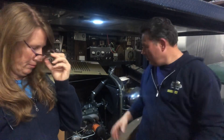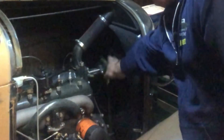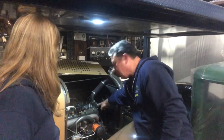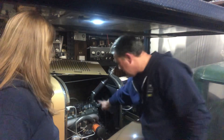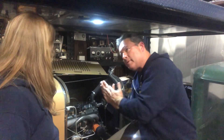Well, at least it doesn't leak — that's good. So, water pump — we'll use roadie here since we're standing here. Typically, what happens is when the engine's running, the fan is pushing air this way. It's pulling that shaft, and it pulls it out away from the head. But inside the head of the Model A is a little stop that the back of the shaft is supposed to go up against.